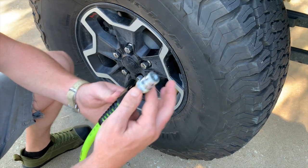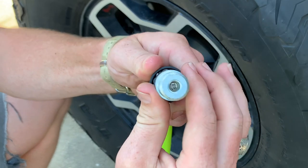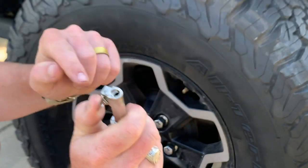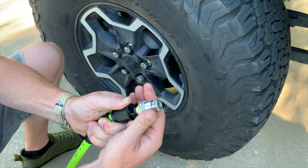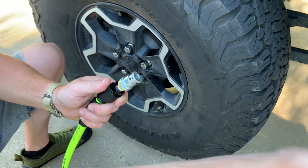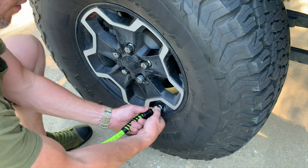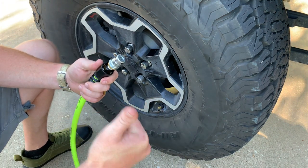Connecting your four-way chuck: make sure it's in the open position. As you can see, there are three claws in there that have a positive grab on all sides of the valve stem, as opposed to the individual ARB one which just has a single claw. Put it on the threads and pop it forward — it's that simple. What's great about it is when it's off, it's not going to leak, whether you're connected to the air compressor or to another tire. It will not come out of this valve. Just as simple as popping it on — boom — and then popping it off.